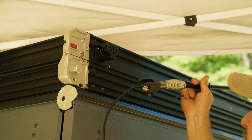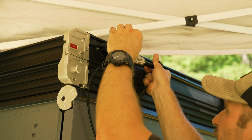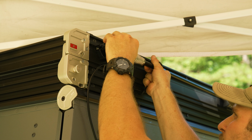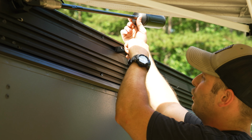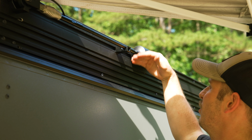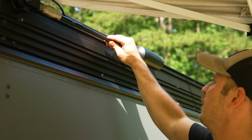So now if we grab the HiBoost antenna, this little pull rod slips out and in. Then we take the last bolt for this assembly, thread locker, and thread it in. And then I've just gone ahead and added the support, which is just a T-nut through here, tighten the Allen, and it clicks right into place and holds the antenna and keeps it from bouncing this way. It's not really mattering, it's not gonna go up and down much, but it keeps it from bending downward. So really, really solid setup.